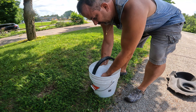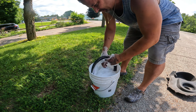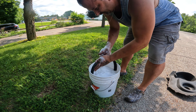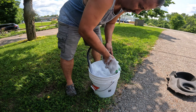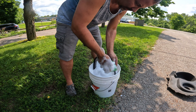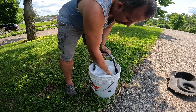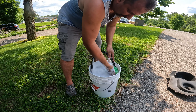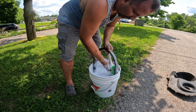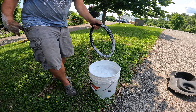Get a bucket of soapy water — Dawn dish soap I use — and just give it a little wash. It's really the edging you're worried about. You should get a brush and brush it. Be surprised how dirty these belts get. Maintenance like this helps the longevity of your belt, your clutches, and just your overall enjoyment on the trail. Nobody likes a busted belt. Do a little bit of work at home — hours of fun on the trail. Rinse that off, should be good to go.